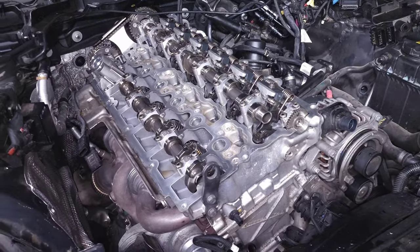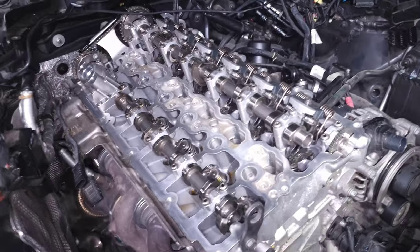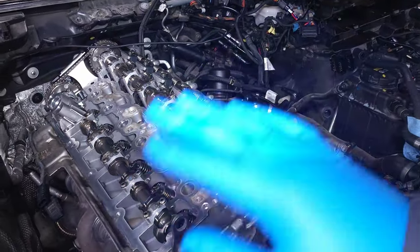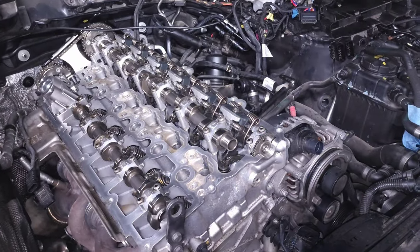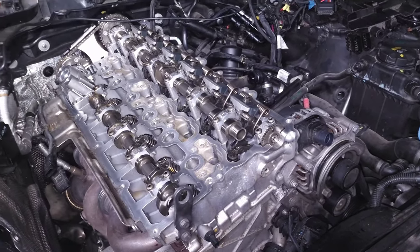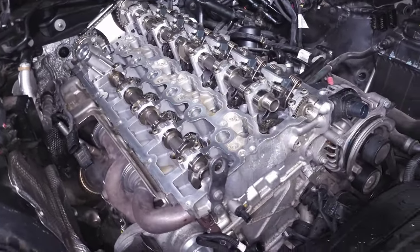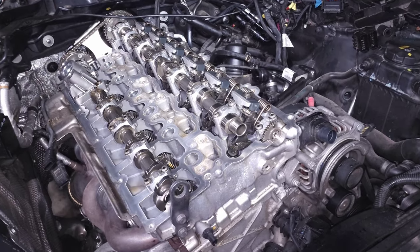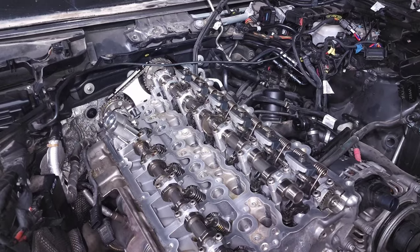Another really cool thing is this is the reason why we're able to remove the diverter valve from our turbocharged engines. They basically control the exhaust overlap to allow extra gases to flow through the engine and out the exhaust without needing to bleed it off or vent to atmosphere. This gives us really good throttle response — we get back into boost really quickly — and overall gives the car a lot more pep while running efficiently with fewer components that can potentially fail.